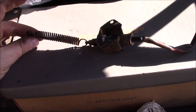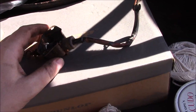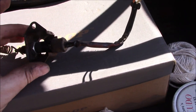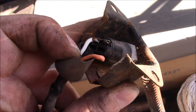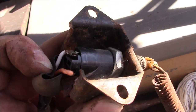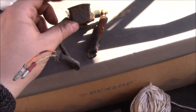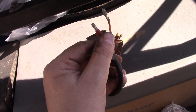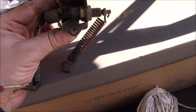This is the brake light switch removed. With the nuts and bolts it was a case of best fit — nothing I had seemed to be exactly the right size. This looks quite new compared to other things I've taken off the car. I wonder if it's a generic part, because when I pull the rubber boot back the wires aren't as old looking or worn as everything else. The part moves nice and freely — no concerns there. I think the problem was probably the wiring, because the connectors weren't very good and the old wiring had been redone. So I'm going to find relevant connectors and pop this back on.